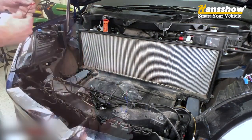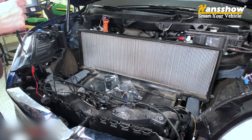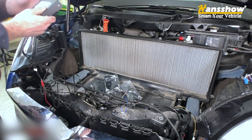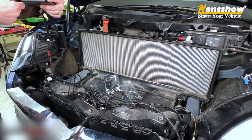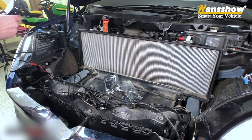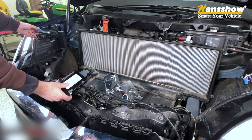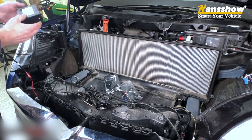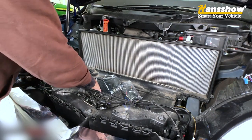I plugged the yellow and red one in. Now we're going to do the same thing here — we are going to intercept the original lock motor wire. We're not replacing it; we're going in parallel to it. You'll feel the lock click, and now you put this back in where the original one went. The lock mechanism faces down. So now we're tied into the lock. Next thing is the buzzer — this goes into the control box. State signal here plugs into there. The struts are going to go into here, and the soft-close automatic door module is going to plug into there.